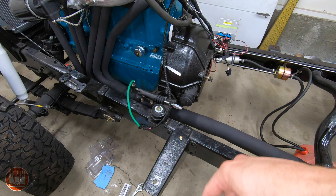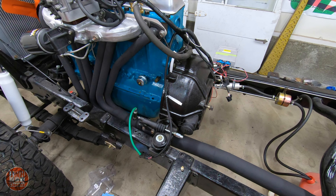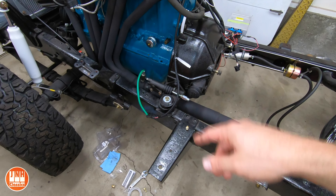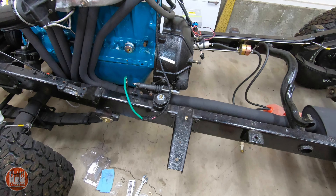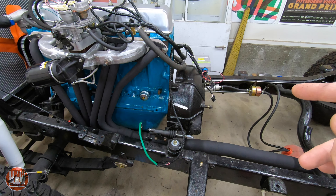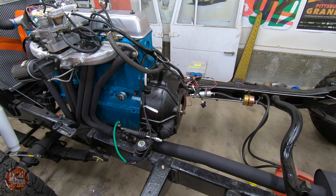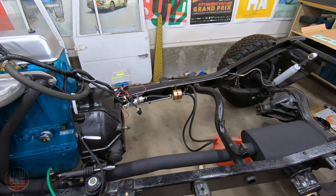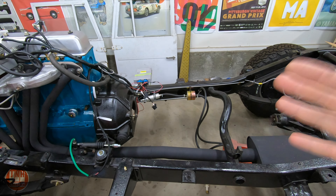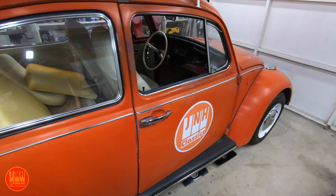The other thing I've been trying to sort out on this engine is getting an oil pressure gauge hooked up. I just rebuilt the engine, I started it up, it runs good, but I need to run it longer and kind of let it run itself in. Before I do that I want to make sure I have correct oil pressure. I bought a manual oil pressure gauge which I assumed would work no problem, but the fitting that goes into the block is just slightly too big. Even when you compare it to the size of the threads on the sending unit they appear to be the same, but this one is tapered and this one is not and it just won't go in there. So I'm going to either have to come up with some kind of adapter to get this pressure gauge to work on this engine, or maybe I'll have to take the gauge cluster out of the tub and try to wire that in to this sending unit so that I can get an oil pressure reading.